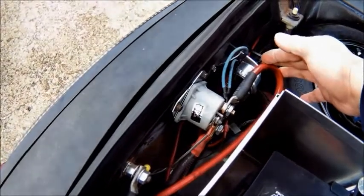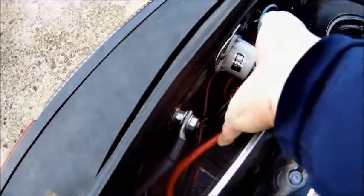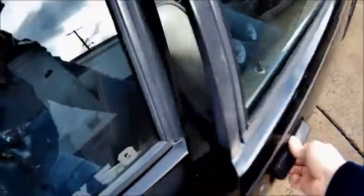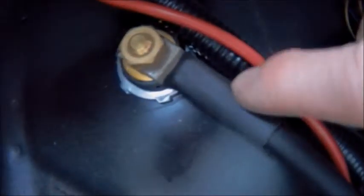So, a positive battery cable coming off of the battery goes to one side of the solenoid, and your cable that goes to the starter itself comes off the solenoid. This is how I have it ran in my car — I have it run all along the floor. I have it run up to this bulkhead electrical connector. This would be the starter cable coming off of the solenoid going to the starter.